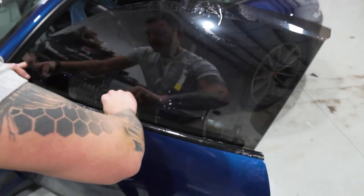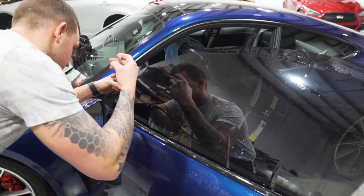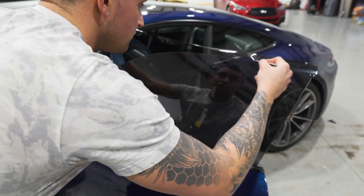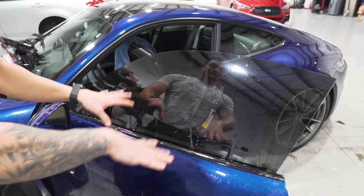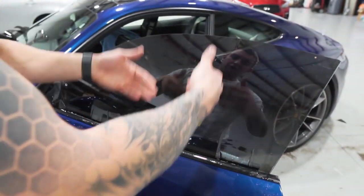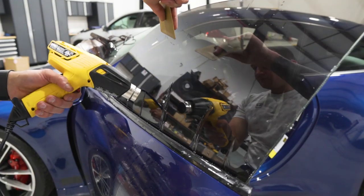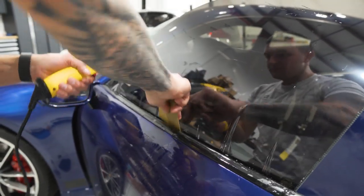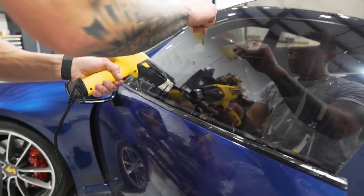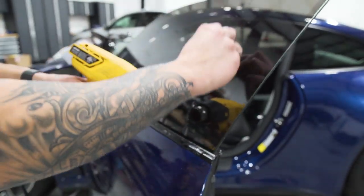Before we shrink those fingers we're going to cut the top edge, then go ahead and shrink them. We left a very slight gap on the bottom edge for the air and water to come out and for them to sit into place after shrinking. Go ahead with the standard wet shrinking method, trying to keep them in the center by working outward from each side.